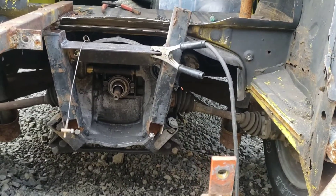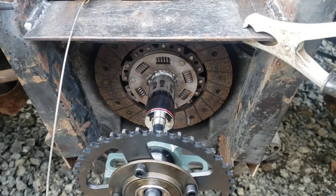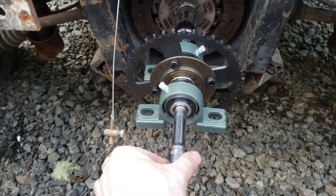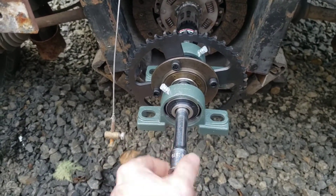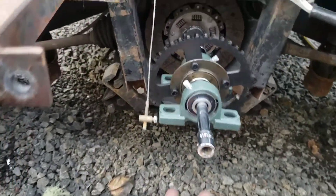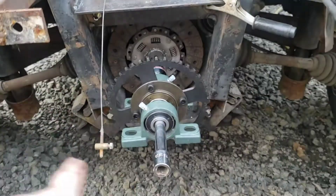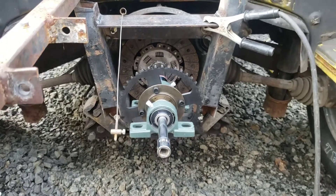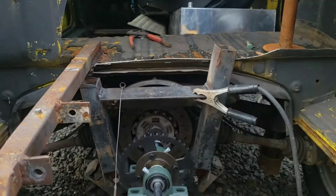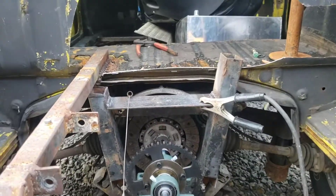So that's what I've got so far — the socket welded to the clutch going out. Right now it's just an extension but I'm waiting on a three-quarter inch jack shaft that fits all this stuff. Then I've got to mount my bearings to a piece of metal that goes across and holds that, and then do a motor mount up here — might even just come straight off that. Not real sure yet.